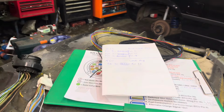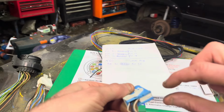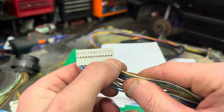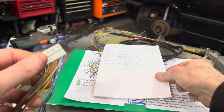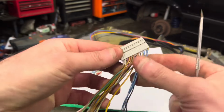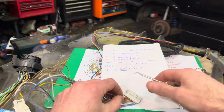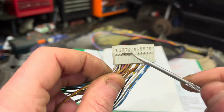So we're going to do the blue one first. We'll take this blue plug, right, and there's a wee tab here. If this is an older shell, it has a wee thing that you slot along here. So we're going to lift that up, pull it out. The numbers are really small, I don't know if you'll be able to see them on the camera, but this one says pin 1 there and pin 13 there. So we've got to turn it over, and we're looking for 17 and 18 on this. So we've just got to count along, 14, 15, 16, there's pin 17 there. You're going to push this small tab down, pull it back, and then you need to push it in when it's in this wee slot as well.